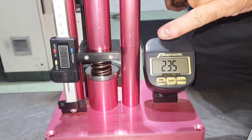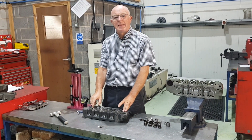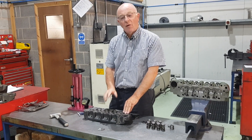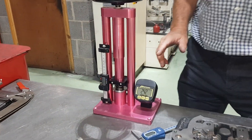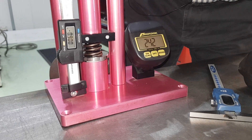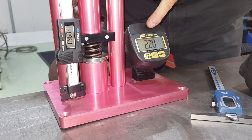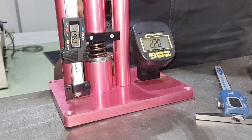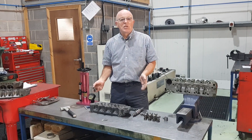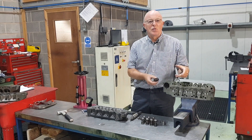We're now on 0.912 and we drop down to 235 — so we've lost seven pounds of pressure on the spring just with 12 thou variation. This was obviously a cylinder head straight off the rack. We have pulled some heads off the rack and seen a massive 60 thou variation on these spring seats — the worst case being 60 thou. If we do a 60 thou variation from 242, we've lost 22 pounds of pressure off the spring. If that valve spring seat was 60 thou deeper, you must rectify the problem.